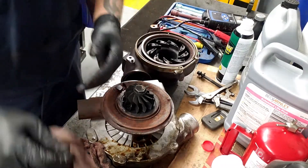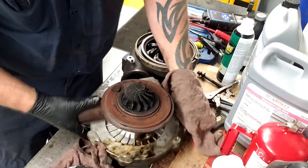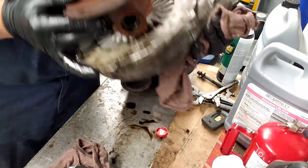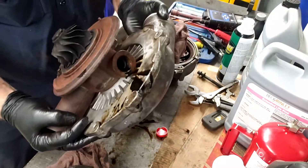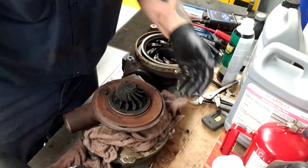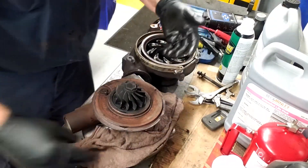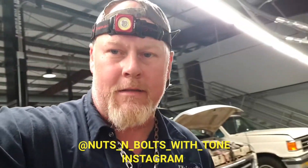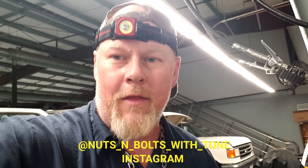This one's not going to go back together unless the customer opts out of replacing it. This thing started off as just needing a turbo cleaning and then it turned into an EGR cooler leaking also, so I'm not sure where this one's going to go. But anyways, this is how you take apart a turbo on a 6-liter: take it apart, inspect it, clean it, put it back together. Save yourself a lot of money just by doing that — these things aren't cheap. I hope you learned something about a turbo on a 6-liter. Thanks for tuning in to Nuts and Bolts with Tone — hit the like and subscribe buttons, hit the bell to get notified of future videos, and check me out on Instagram at nutsandboltswithtone.